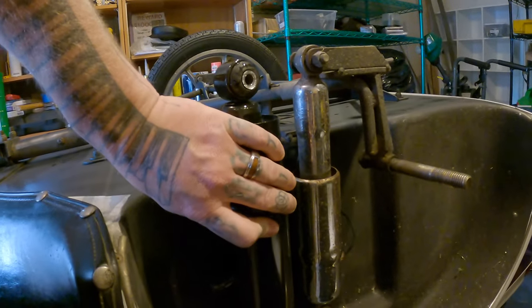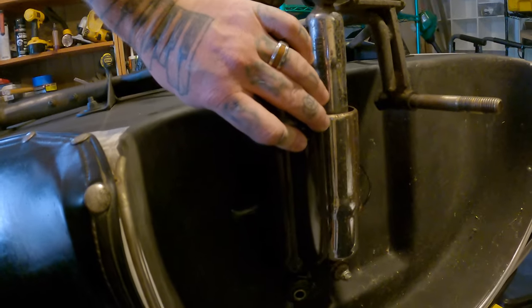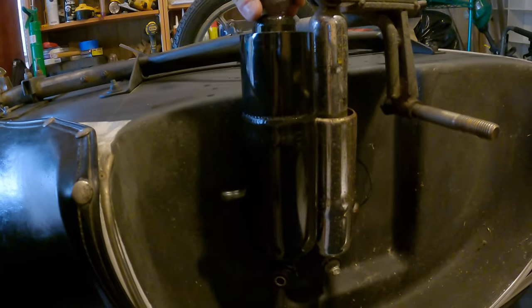They're much bigger in diameter than the shocks I have, and I've had to modify them to get them to work. I had to drill out the eyelets so that I can get a bushing of the correct dimensions so that it would bolt up top. On the bottom side, the eyelet is so wide that it won't slide on enough to get enough purchase to get a nut on it. So I think the plan is to get a sex bolt for the bottom, where the female end is also kind of like the bushing, but will thread on. I know that probably doesn't make a lot of sense, but I feel like I'm dialed.